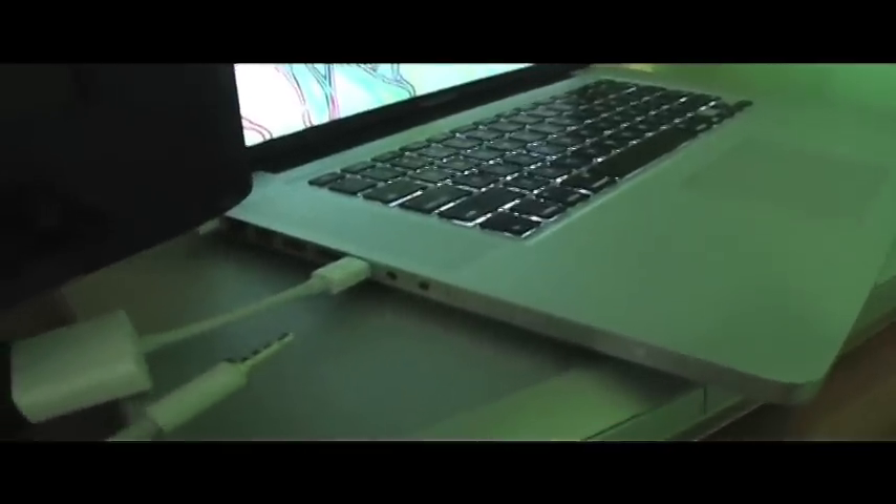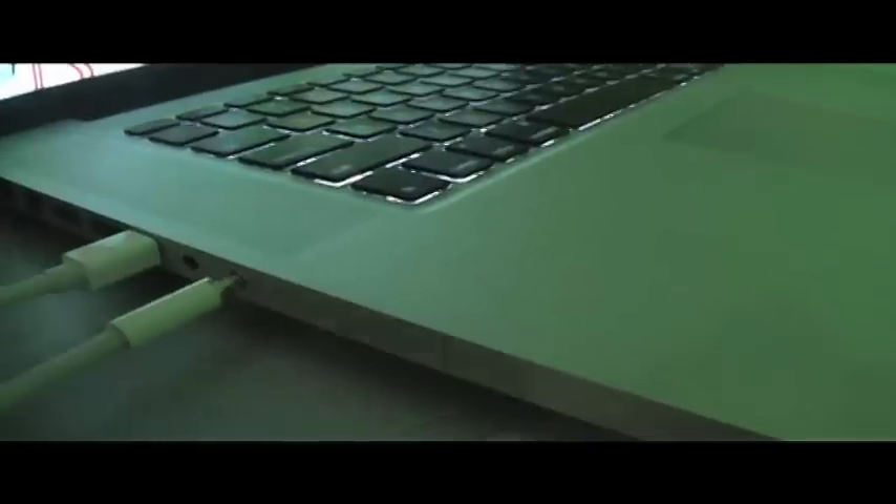Just to make a note: some people will not need that little black adapter for the audio. Some of you won't need it because your TV will say DVI-IN and have a red port and a white port right there — you just plug the red and white cable straight in. But some people's TV will say DVI-IN and have one little circle port — that is where you do need the adapter. Then get the headphone end of the RCA cable and plug it into the headphone jack on your MacBook.